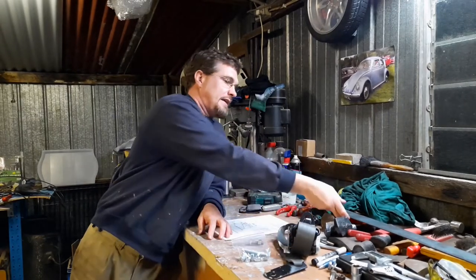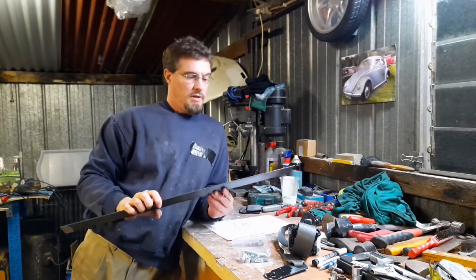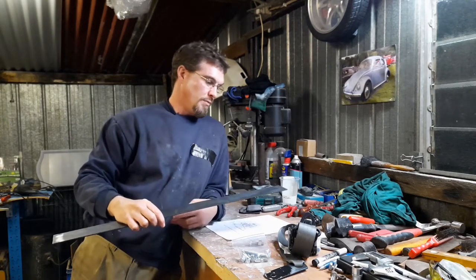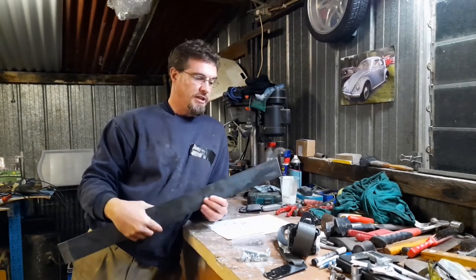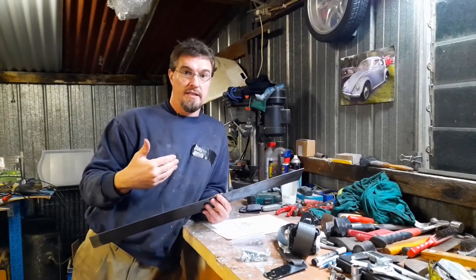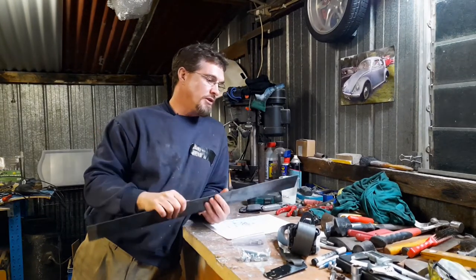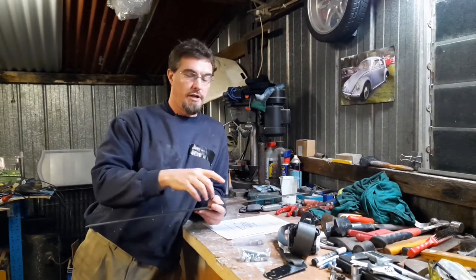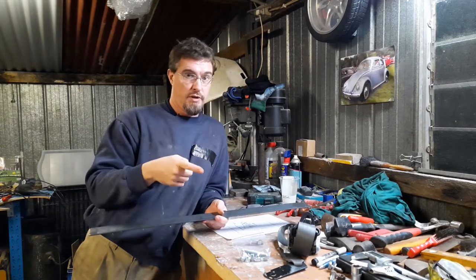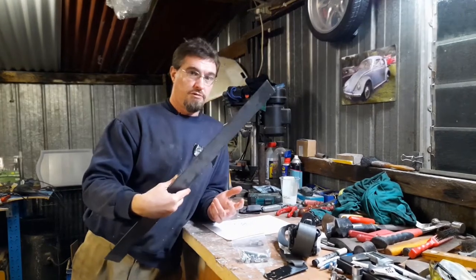Then you're also going to need some steel. This is 3mm thick, and it complies with my local legislation. It acts as the spreader plate behind the interior structure of the vehicle. So it spreads the load so that your nut and bolt doesn't pull straight through the metalwork. Because don't forget, your bodywork's only 0.8, 0.9 of a mil thick. So this is 3mm thick.